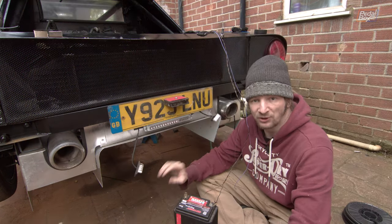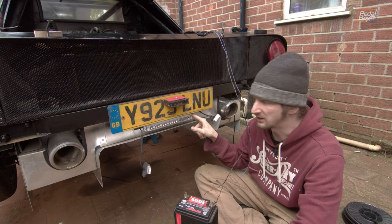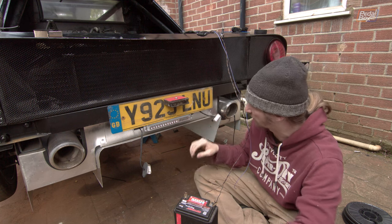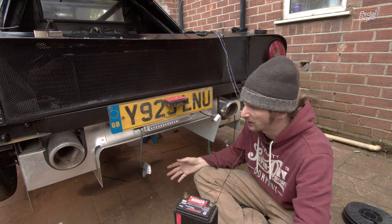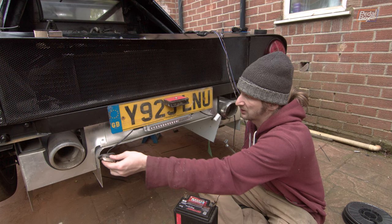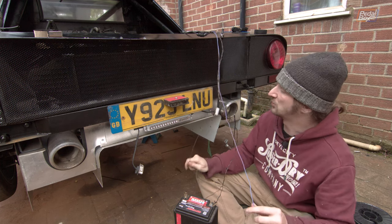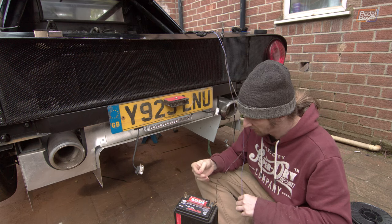We've made up a nice little wiring loom for these, taped everything together so it's quite neat, and sent it all through the big cavity in front of the number plate where the old lamp's wiring went through. While we were in there we noticed some cables were contacting the edge of the aluminium plate at the back of the diffuser, so we put some rubber edging strip around all of that to protect it. We got carried away and went around the exhaust tips as well, which we would have had to do eventually. The number plate is held on with a magnet to give us locations for everything, and cable lengths are confirmed — looking pretty good.